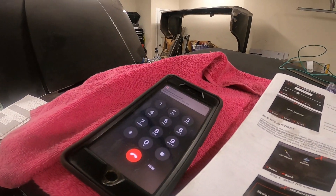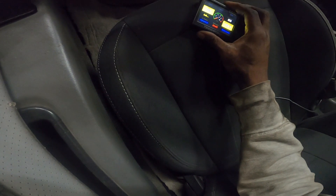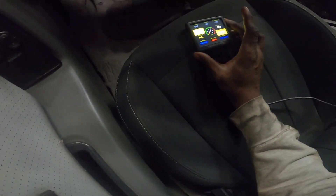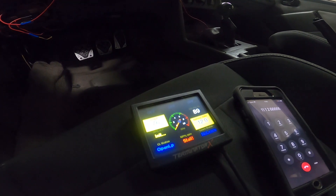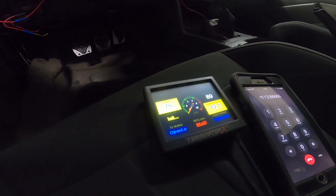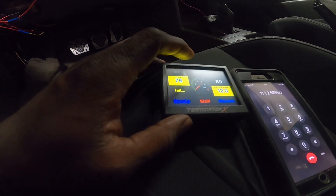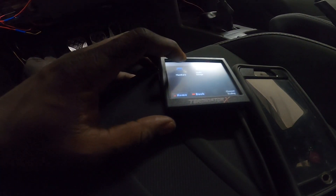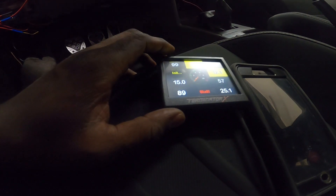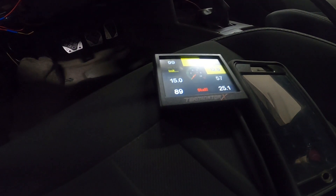Where would I find static at? It's just steady at 100. I can't say if it is or not because I kind of don't know what you're meaning by that. Would I be able to read when I'm starting it? Yeah. Where would I see that at? Okay, so we need to go to Monitor, Multi-Gauge, Sensors. TPS is at 7. Okay, let's do a TPS auto set really quick.